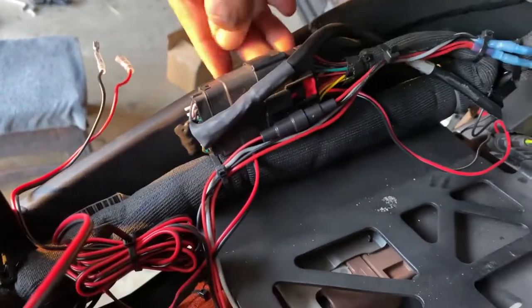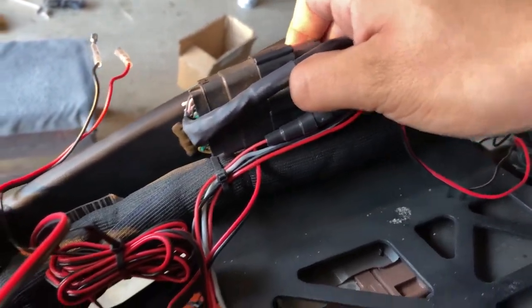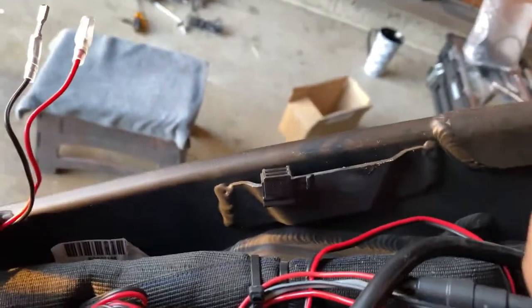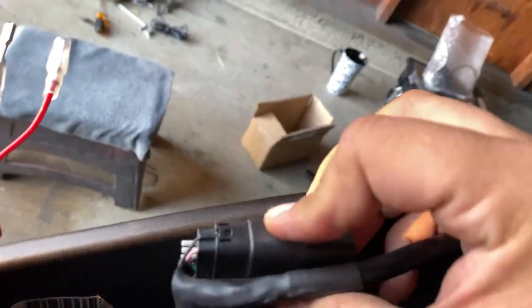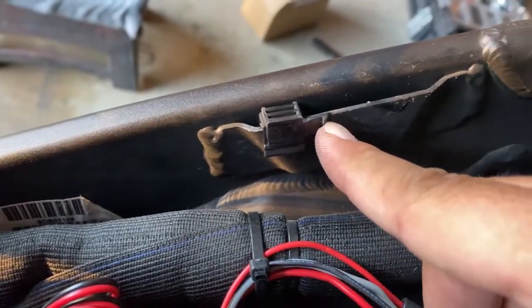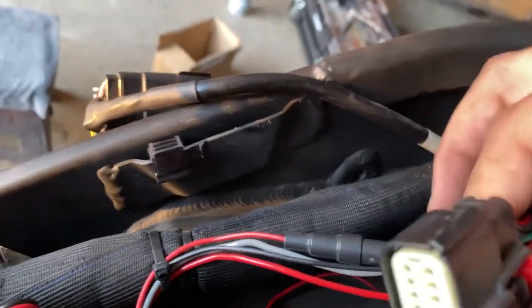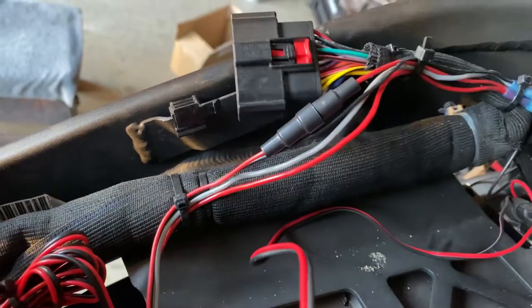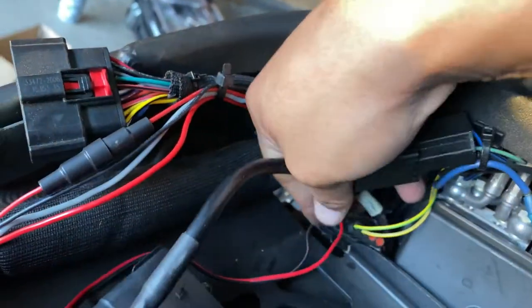You want to undo this safety clip, or whatever you want to call it, and then you should be able to push down and pull. To come back and show you guys what I ended up doing — this here has a latch where this slips into. You gotta just undo this from the back side using a small flat-head screwdriver, and undo this — basically these two just separate. This would be the cable you are trying to get out, and now snake it all the way back to the front and out of the bike.